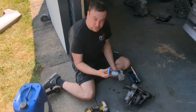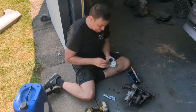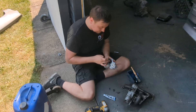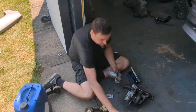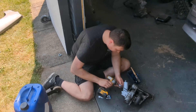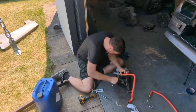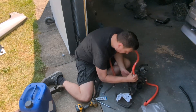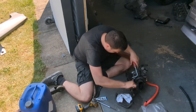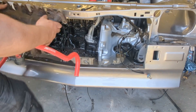I've got no gasket for this so I'm just going to use some gasket sealer, essentially smear it around the edge and bolt it back together. The intake to the turbo is held on with six M6 bolts — I'll loosely put these on with the impact driver then torque them by hand. Then we move on to the coolant lines: there's one on the front and one on the rear, bolted on with a threaded union. Lastly we fit the oil return, which just pushes on and has a couple of jubilee clips holding it.